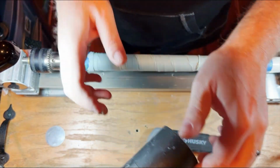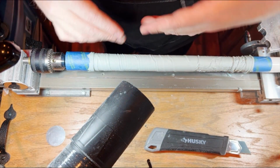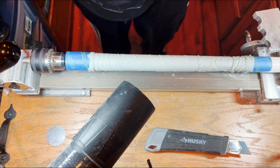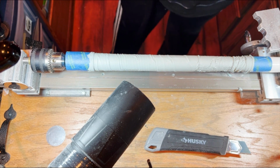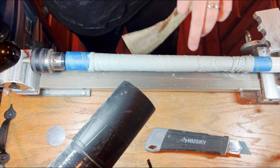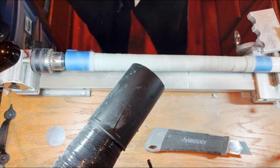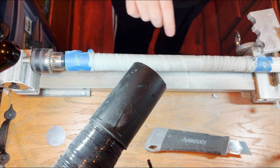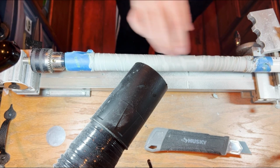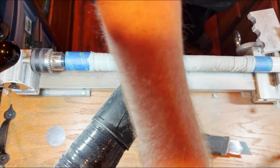I'm gonna take some 100 grit, sorry, 150, and just take down some of these high points, so when we apply the next layer of Bondo, it doesn't get holes and gaps. So I'm gonna turn on the dust collector, take that same 150 grit, and we're not looking for a super smooth finish, just some of these high points. Like I said, just so we can get that Bondo into some of those crevices. Alright, we mix up another batch of Bondo, apply, and come back.